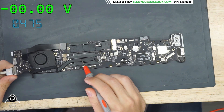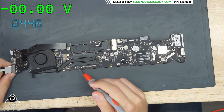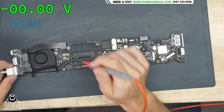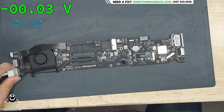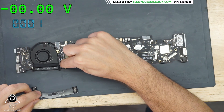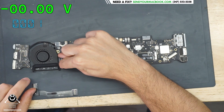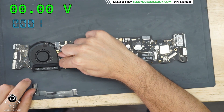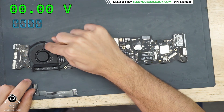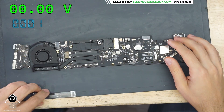I'll give him a new fan — that fan sounds like garbage. I don't know if that's because I kept a magnet on it when it was spinning or because there was some pressure on it, but I'll give you a new fan. I'll also have to give this one a new screw because whoever was in here before long-screwed the fan. There was a long screw and there was a screw missing. I'm guessing they lost this screw, and then thought: let me take the screw that goes there and put it here. Very bad. You can take the screw that goes here and put it there, but you cannot take the screw that goes there and put it here.